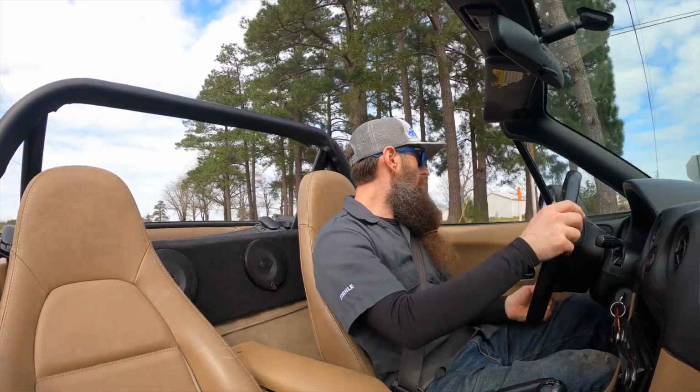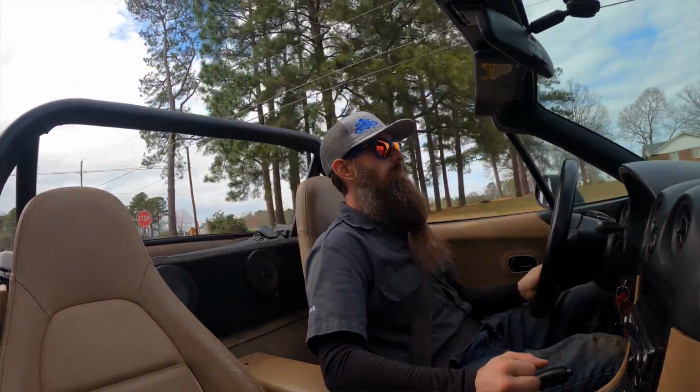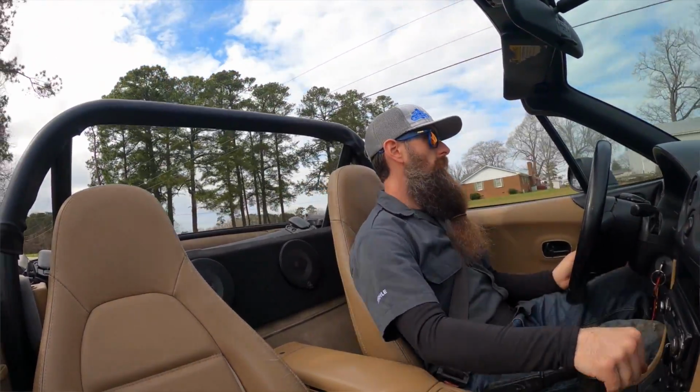So there's our step-by-step strut replacement. I went ahead and did the other 3 corners of the car. It's important to remember you need to do at minimum the whole axle, which means do both rears or both fronts, depending on what you're doing and why you're doing it. Doing all 4 may be the right solution. After putting our wheels on, properly torquing, and one final visual inspection to make sure we got everything taken care of, it's time to take her on a test drive.